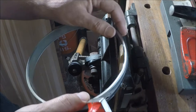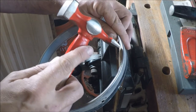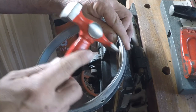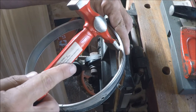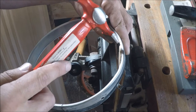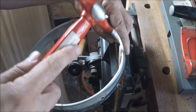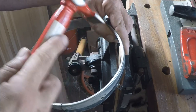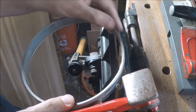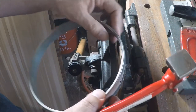There's a couple of little wrinkles in this thing — there's one right here and one right here. I don't have a dolly that'll fit in there, so I've gone back to my stick and reshaped it. I'll just lightly tap that because I don't want to scar this metal up. When you're doing this kind of work, most of the time you want to be doing what they call off-dolly. You want to be striking off of that support so the metal bends. If you strike onto a dolly, you're going to be making the metal stretch — which may be something you need to do, but it's more of a finishing technique.